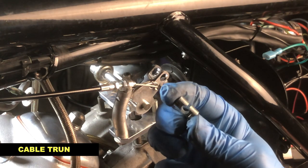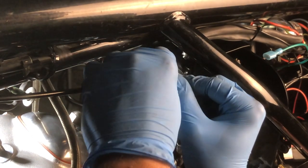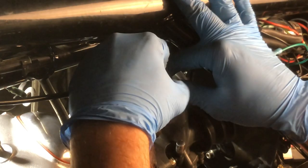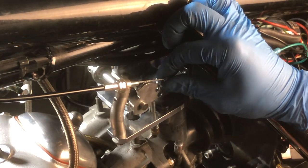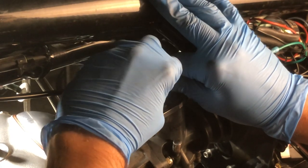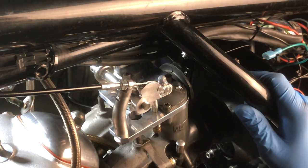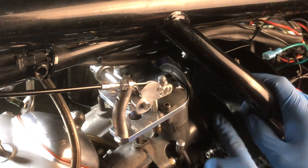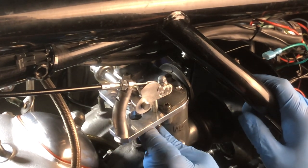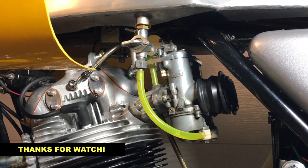With the barrel fittings, put the slot side out and go through the armature, then lift the cable so it fits right in. Repeat for the other side. The last step is to install the throttle cable onto the bracket — lift these up and go into the top slot. That completes the installation. It'll just be a matter of fine-tuning: synchronizing the slides, making sure your cable adjustment is correct, and finally setting your idle adjustment.